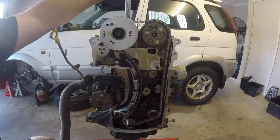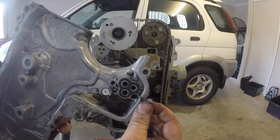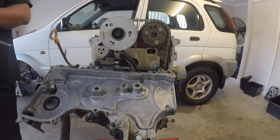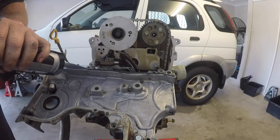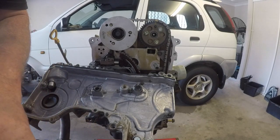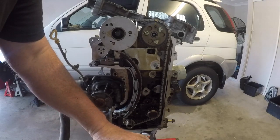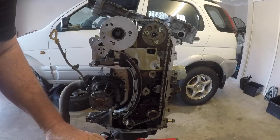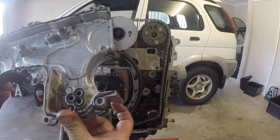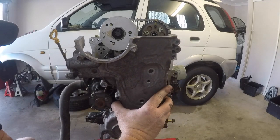You may also need to rotate the cams a little bit just to make sure that the timing tensioner has fully expanded and it's locked into its current position. The next thing is we need to put the cover on here — there is a small gasket that's in here and you should get that in your gasket set. You do need to run a bead of silicone around the mating surfaces of this timing chain cover, as there is no gasket actually provided here. Also don't forget the top of the sump — that needs a bead of silicone as well. Make sure when you're putting these beads of silicone around that you're not overly generous, but you don't want to go too sparingly either. Here is the new gasket and I've just put a tiny dab of silicone on the underside of it just so it sits in place and doesn't come off when I put it together.